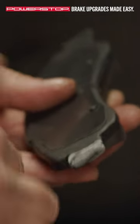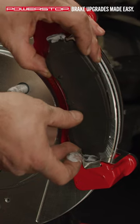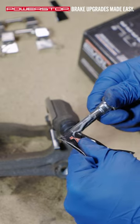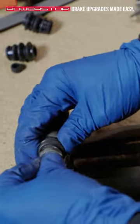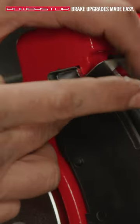It's important to properly lubricate new brakes during installation to ensure noise-free braking and proper system operation. Lubricate the moving and sliding components with a minimal amount of lubricant — a thin layer is all that is needed. Place lube on all the caliper bushings, slide pins, and clips installed in the caliper and on the pad mounting tabs.